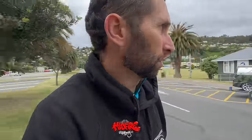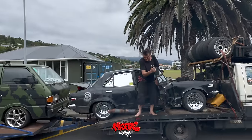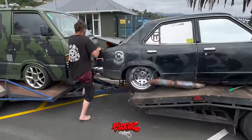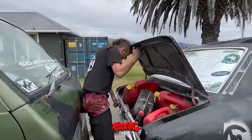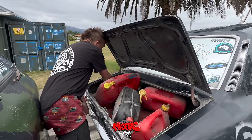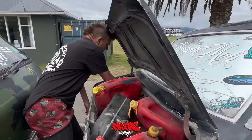That sounds perfect. Just put those plugs on - what's happening is when he's doing all those skids, the plugs on top of the injectors aren't staying on. Now we've got them all fitted, we just gotta fit those injector plugs and then you're good to go. You shouldn't have any more problems. That sounded beast mode - that's what I want. I'm pretty happy with that.